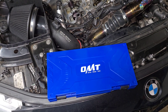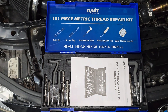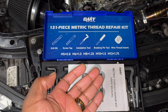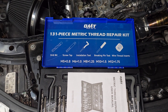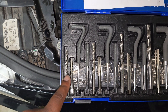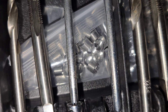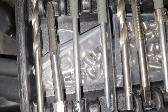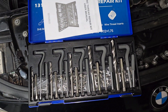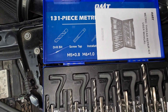So this is the kit that I bought — I'll have a link to it in the video description for my Amazon store. I really like this one for a couple of different reasons. One, it actually fixes the threads, and two, you've got a bunch of different sizes. Especially for our cars, they're all pretty much metric, so I've got this metric kit and whatever I run into I should be able to fix. The way it works is we're going to drill out the hole, then re-thread it, and then take one of these threaded inserts and thread that into the hole. That repairs the hole so we can thread the screw into this insert. For this specific one on the valve cover, we're going to use the M6.